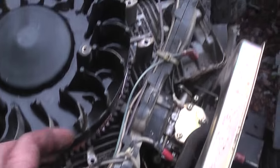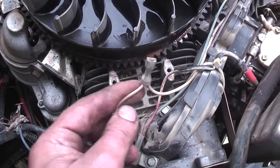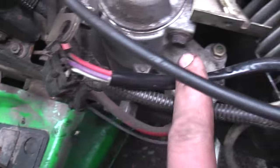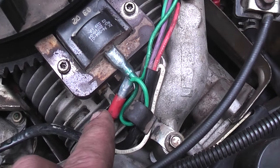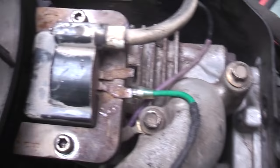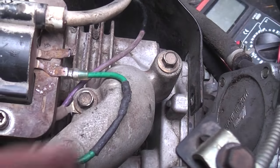Here's what you basically need to have on the engine you're repairing: you've got to have just a lead like this that goes to your white ignition kill circuit wire. You're looking for your white wire coming from your wire loom into your engine. It was just dangling down there because when the smart spark uses the ignition kill, it goes right to the box. It just had a regular bullet connector on — I used the wrong color but no big deal — on this green wire with a plug-in terminal on each side, and just soldered to that end.